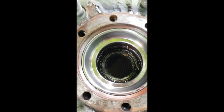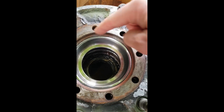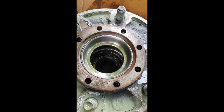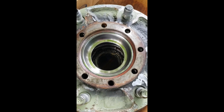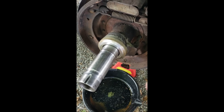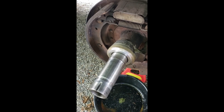There are four seals total, because the inner bearing also has another one of those inner retaining seals, which you can't actually see in this picture because the inner bearing's in the way. There's a seal between the bearing and the bearing cup, held in by the separate seal retainer — on both ends of the hub, and on each of the bearings, there is an O-ring butting up against parts of the spindle to keep air from leaking. On modern trucks designed from the start with tire inflation systems, I believe air is delivered right into the spindle and into the hub without this sleeve configuration, and instead of four seals there might be just two.